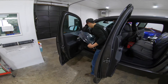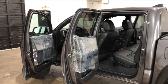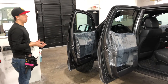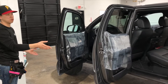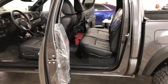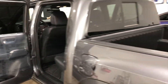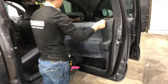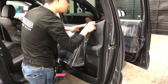The customer is not really going to notice everything, but as an installer you're going to notice it. If you install and do this for a living, you know what you're looking for — same thing as wraps. With wraps, corners, pre-stretching of corners, post-heating and stuff like that never comes to mind to the customer. But as an installer you see it. You can go around a wrap and understand, oh, they didn't pre-stretch this corner and now that's why it's lifting. With window film the same — you can see if you fought the film, you can see the creases, the marring, depending on what kind of hard card or squeegee tools you use.